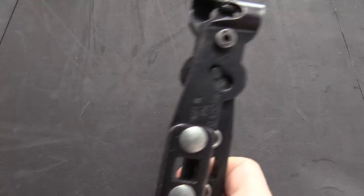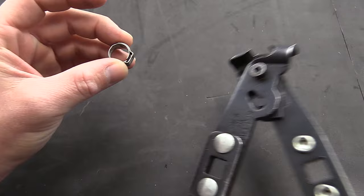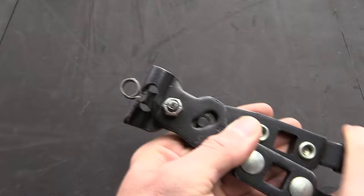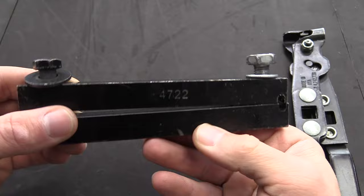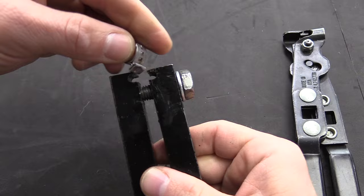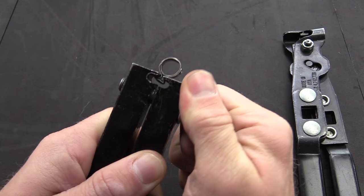This is a cool battery-powered heat gun I wish I'd had earlier in my career. Axle boot failure was incredibly common, so you need good clamps to crimp the boot clamp together. For small or soft clamps, these hand crimp tools work really well — just put it on the clamp and squeeze. Unfortunately, around the Mark V and B6 generation the clamps got much more heavy duty and were a real struggle to do by hand. They have half-inch drive openings for breaker bars, but that's incredibly cumbersome. What I found works much better is a heavy-duty set where you use a drill, impact, or ratchet to twist the bolt — it does a much better job on those heavy-duty clamps.